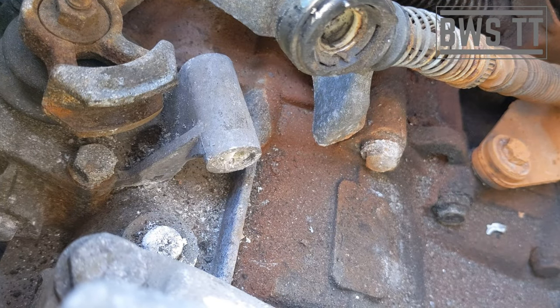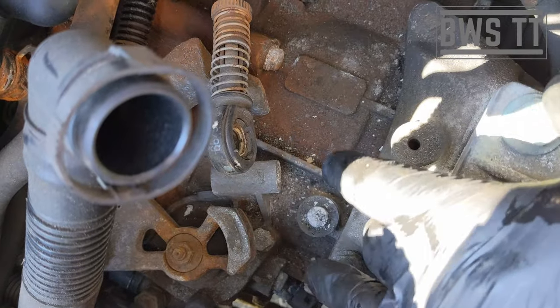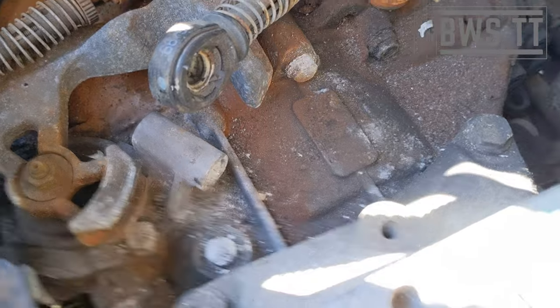There's no point in me starting her up yet. Let me show you a quick little fix I'm doing on the gearbox — the bushes that live inside there are dead. That's part of the shifter assembly, so I need to drop the gearbox down slightly and take this part off so I can get in there to clean the old remnants out properly. The aluminium's corroded so the plastic has just expanded and it's really tight — won't come out, it's all knackered. That needs cleaning out and new bushes in there for the gear selector to work properly. I've done a little separate video on that and might be able to put the clips into this one.